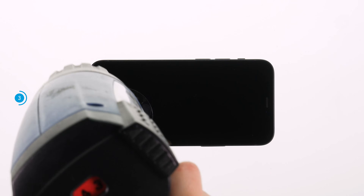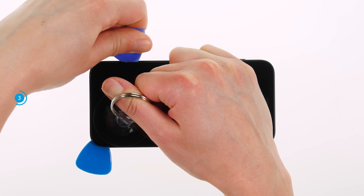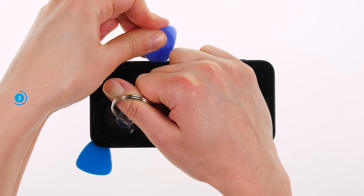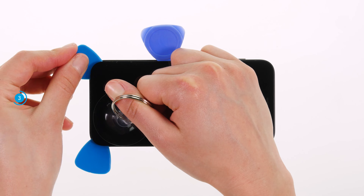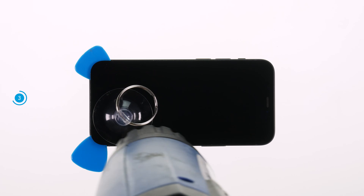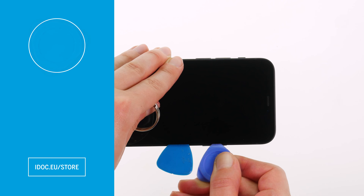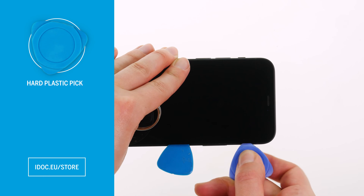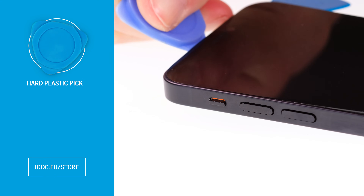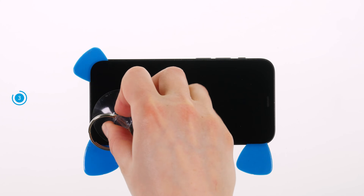Enlarge the gap with a flat, stable tool like the iFlex — its particularly sharp edges make it easier to insert. Reheat the display at the spot where you are working and run your tool around the edge of the display to loosen it piece by piece from the rear case. Since you can easily scratch the metal frame with the sharp edges of the iFlex, we recommend continuing with a hard plastic pick as soon as possible. Its pointed, flattened corners can be easily inserted under the display, and the compact shape allows you to apply enough force to pry the display out piece by piece.